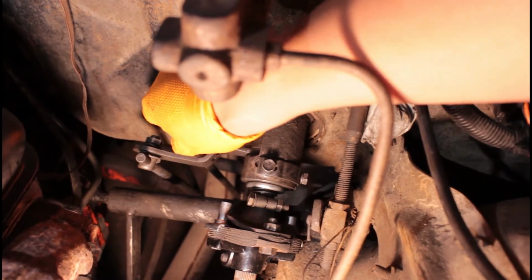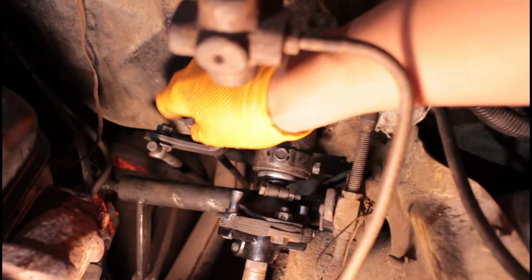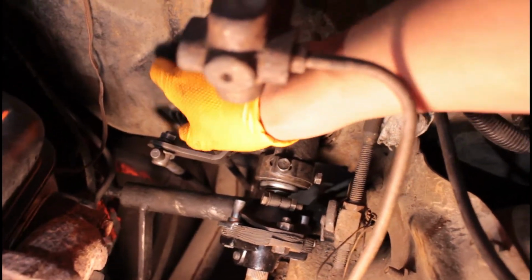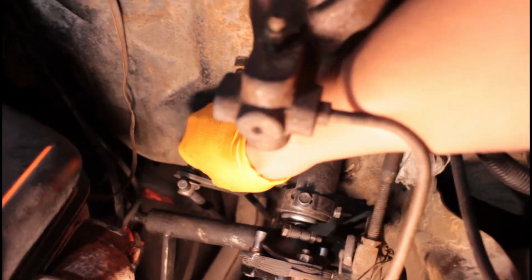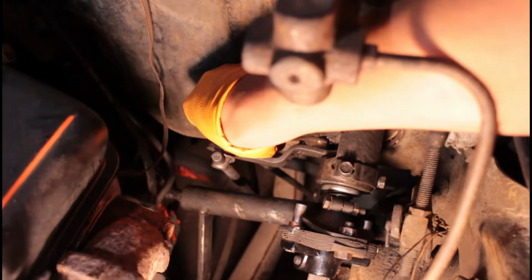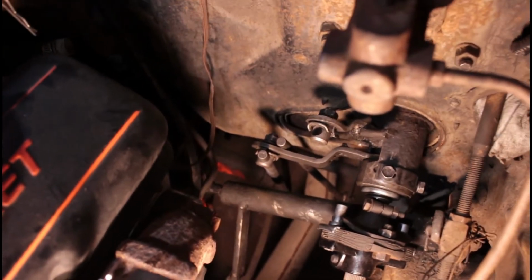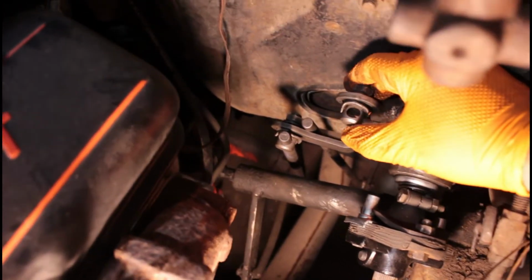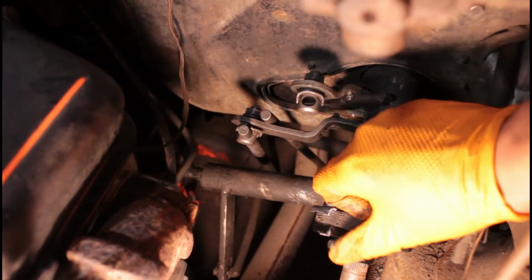And once it's in neutral, you'll want to then tighten it. And then once it's tightened, you'll want to go through the gears like this, manually pushing it in and out. So this will be your second and third, see? And like that. It essentially goes up and down. And for this, you want to have it such that the length of the rod, as bolted to this here, can accommodate it traveling all the way down and then all the way up.